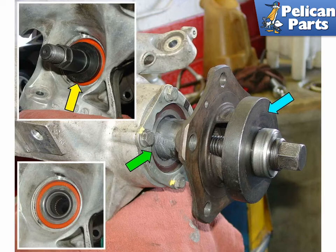With the new bearing installed in the wheel bearing carrier, it's time to install the hub back into the inside race of the bearing. This is performed using a wheel bearing installation tool. Using a circular backing plate that is the same size as the inner race, the tool pushes the hub inwards while compressing on the inner race. Crank down the bearing installation tool until the inside surface of the hub rests against the inner race of the bearing. Test the hub on the bearing with a few test spins — don't be alarmed if it doesn't spin too freely, as new bearings are generally pretty stiff at first.